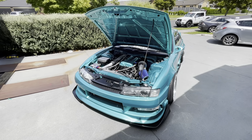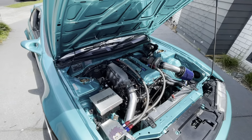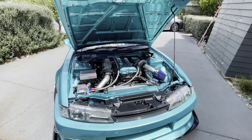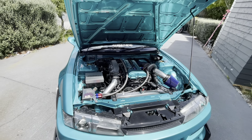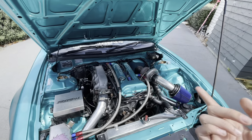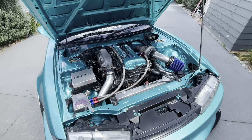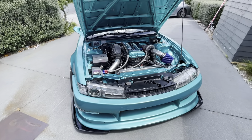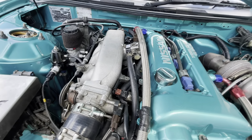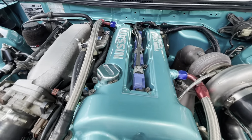Here's an unreleased sticker too, just about to drop this in the new year. So here we come to the engine bay. I've done a walk around on this before but for the new viewers — it's an S15 SR20DET. This is a new motor that came out of an S15, one of my friends Luke had it back in the day and did a few track days in it. It's got a Tomei 256 cam, head gasket — not sure about studs — but it's on 267 kilowatts and 450 newton metres of torque just at 16 pounds of boost.